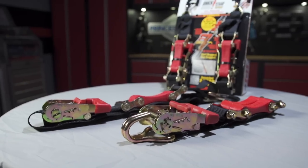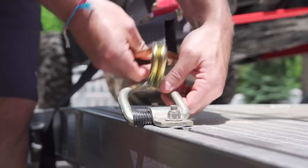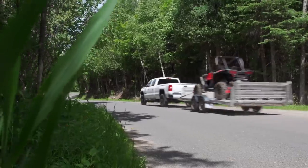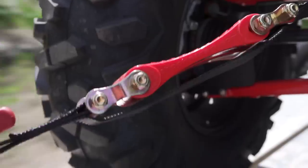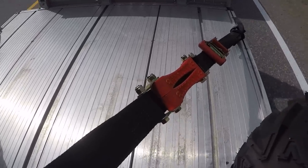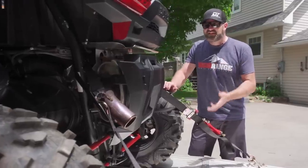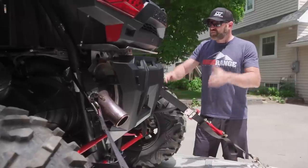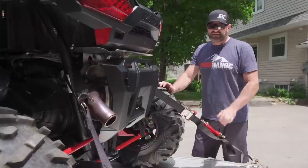Shock Strap tie-downs solve that problem by adding a urethane shock strap midway up the webbing that is stretched as you tie the vehicle down, but that also compresses as the vehicle sags while being towed. This elastic stretch provides constant tension, taking up all the slack you'd normally see in a traditional strap, keeping your tie-down super tight no matter what. This safety strap is here only as a last resort backup in case something ever did happen to the urethane elastomer. The extra confidence this gives you while you're tying down your expensive powersports toys makes these things pretty much priceless all on its own.